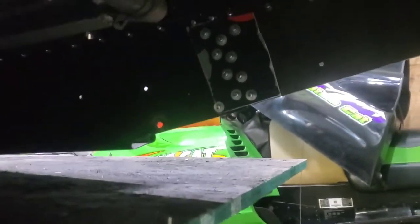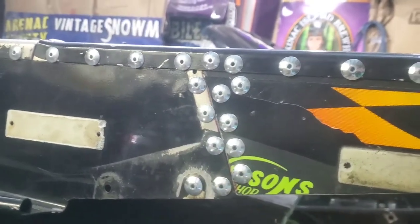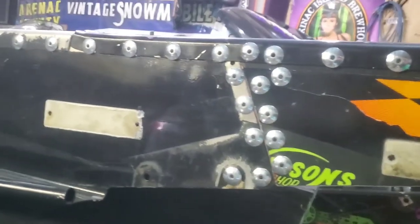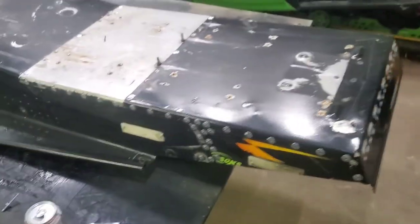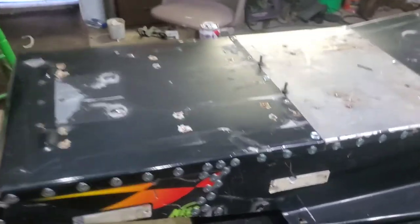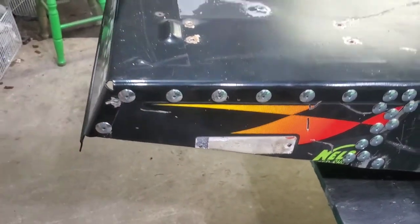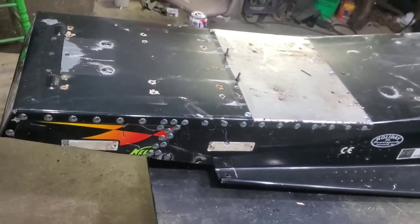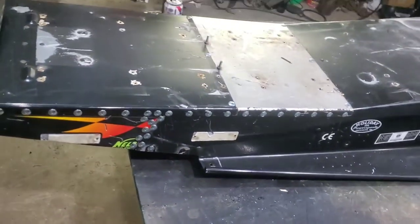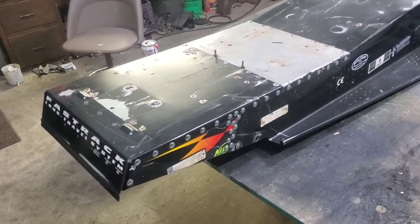On the inside, all I ended up doing was using an old piece of tunnel to connect the seam. It ain't going anywhere. I plan on running some sort of bumper down here — maybe a Snow Pro round bumper — I haven't quite figured out my game plan yet. I also didn't want to extend it back off the stock tunnel and have that big mailbox hanging off the back like the Powder Specials and earlier Mountain Cats — I hated that. And I didn't want to have the track and suspension stop here and have a big wheelie bar on the back. So it might be a little shorter tunnel-wise versus the track and skid sticking out the back, but that was the end goal.